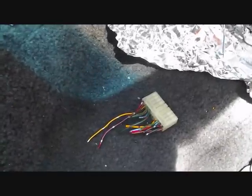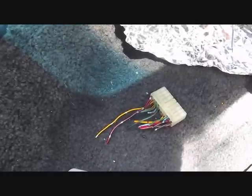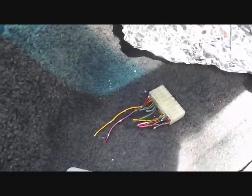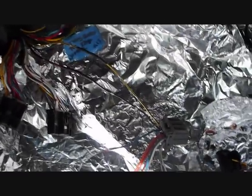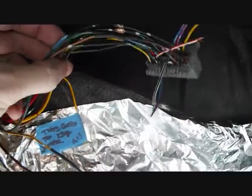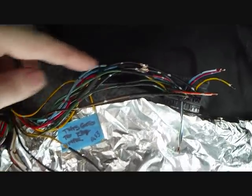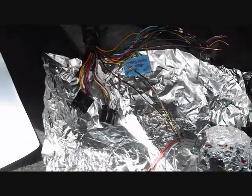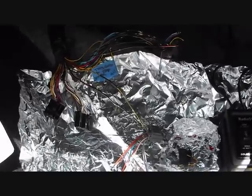As you can see, I got my first wire done on the OBD0 clip — that's the '89 side, not the OBD1 side. First one out of three. You can see I've got the second plug going in there for the OBD1. Pretty much most of the other ones are done. I've got a couple left because I'm about to splice for the VTEC wiring, so I left those, but most of them are all pretty much done.